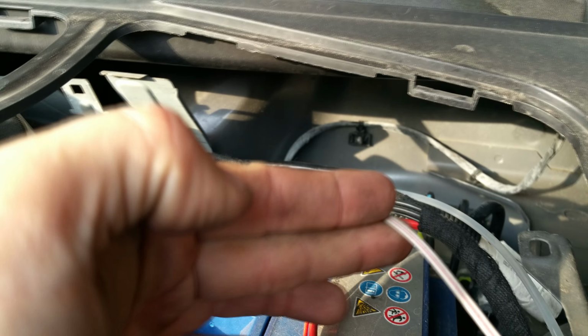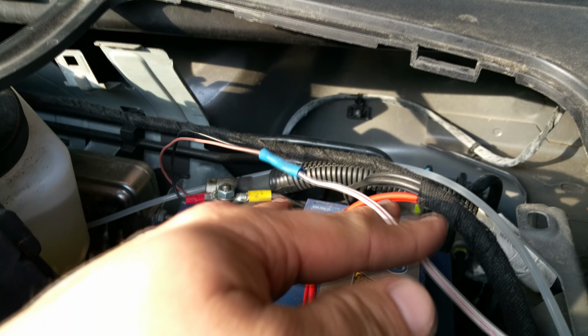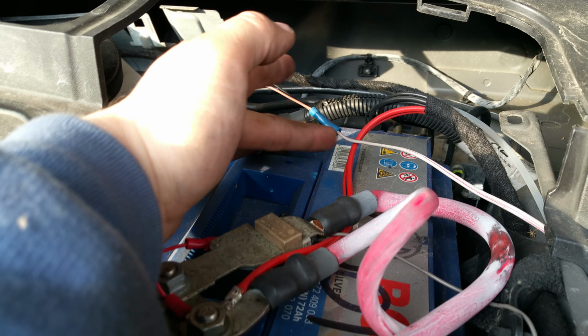And you want to put your black and brown cable as well. They need going up to the earth, or the black. Now that's the same. And again, the cable wasn't long enough, so I used 12 strand cable. Now that's just speaker cable. Joined them both together because they're both neutrals, earths, so that didn't matter. And you will have to do it at the ECU as well somewhere, or where the cable stops. Just chop the end off 6 inches or so before the end, because it's got the 2 forks on it, and just splice it in.